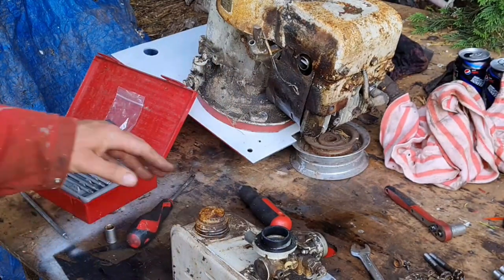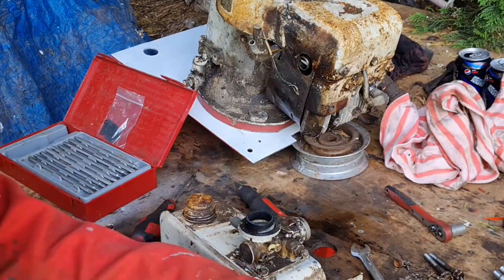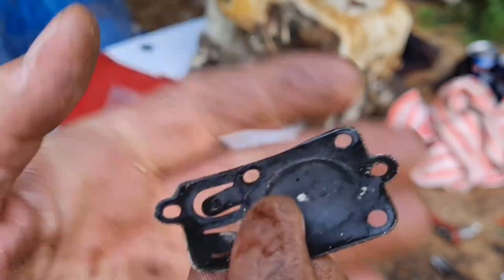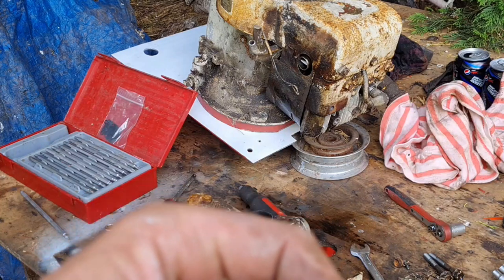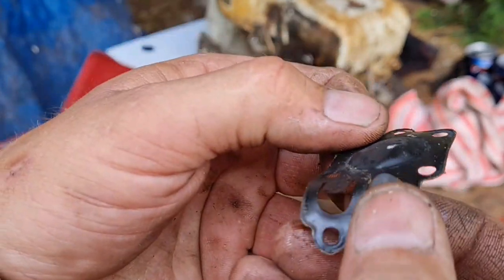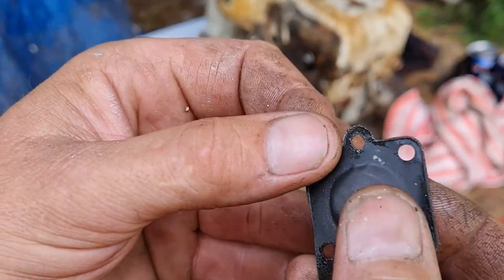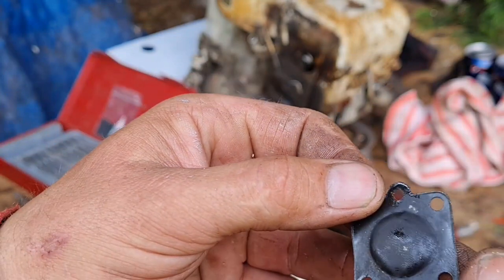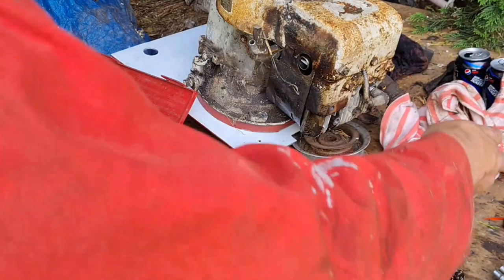There we go, that's our carb diaphragm done. You can see our old diaphragm. If you look, it's gone like a balloon. It's ballooned on this side. See what I mean? Look, that's not holding its form. That's where the spring over the ears has sat, and that's now not pushing backwards and forwards. That's just putting constant pressure on it. So this diaphragm, knackered. So chuck it away.